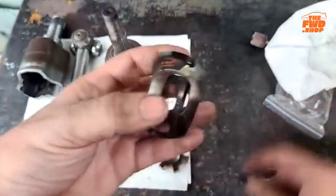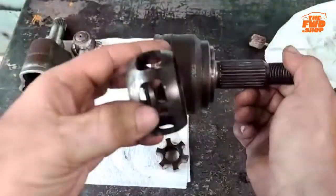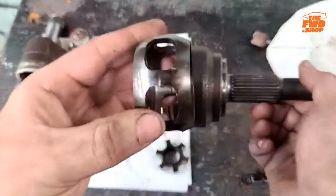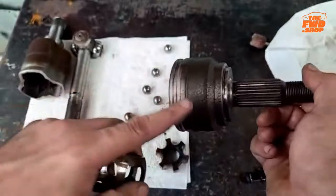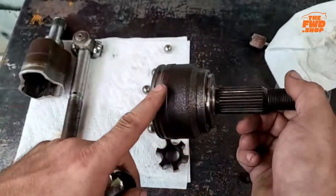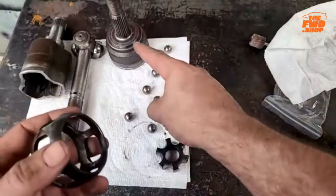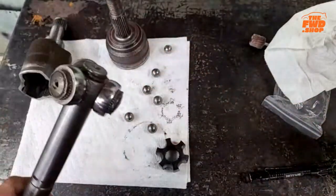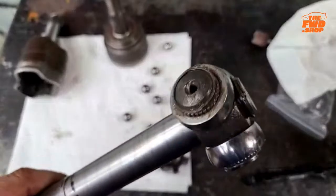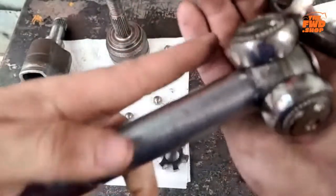Okay. That side is closer to the hub face. That is all heat from me overheating the brakes like crazy and overheating this axle through the hub, all the way up through the axle. So that's what that is. That's why the grease inside this was black. And the grease inside this, you can even see it, is not. It's brownish, right? It's brownish, but it's not black.